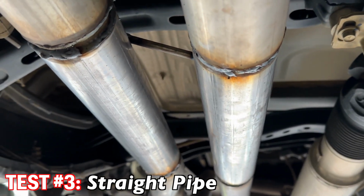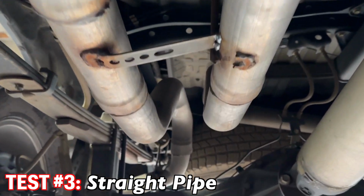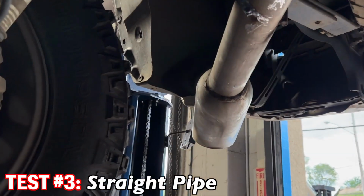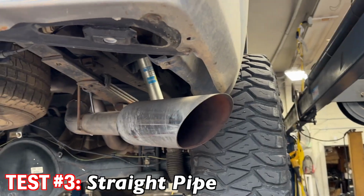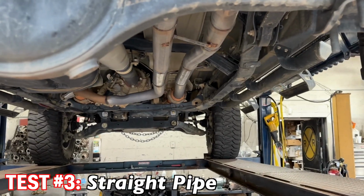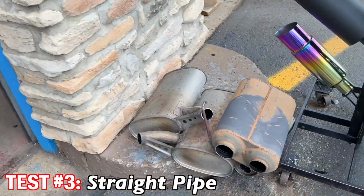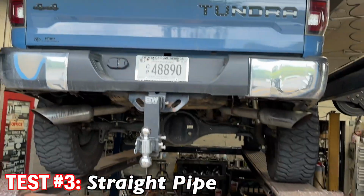We did a muffler delete on it. Had a Flowmaster Super 40 on it. Took it off, ran 3-inch pipe out the back on each side there and there. Fixed his hangers for him, added some hangers on it. Into massive 5-inch angle cut tips out the back there and there, as you guys can see. Came out really nice, real clean. There it is, 3-inch system all the way back. Just gives it a lot deeper tone. There's the Super 40 that was on it that we cut off right there. Flowmaster. We'll let you guys hear it in a second.